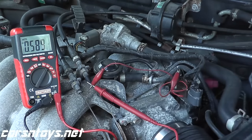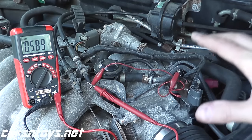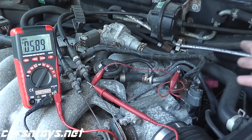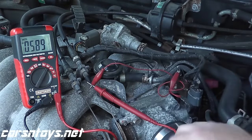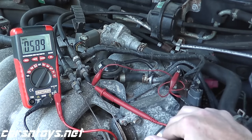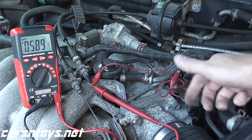Now if you don't have a multimeter, or don't know which wire to touch, forget this whole process — you can just start the car. With the car running, you can adjust the throttle position sensor and you'll hear the idle go up and down. The only thing you'll really need to know is the base idle speed. For this vehicle it's 700 RPMs with an automatic transmission. For anyone with a Nissan or Infiniti, send me a message — chances are I can dig up the correct voltage, which wire to touch, and what the base idle speed is.